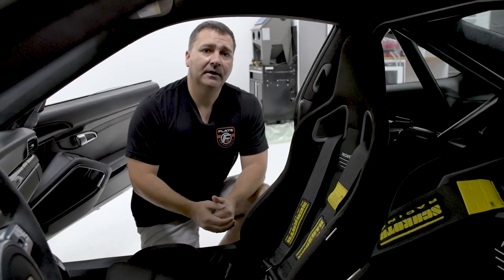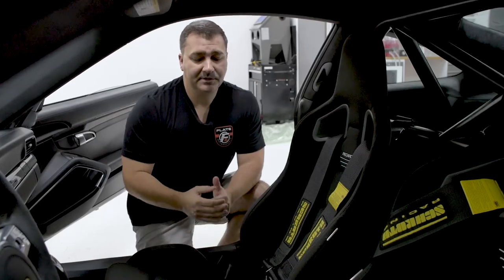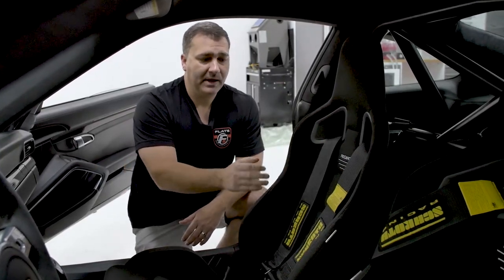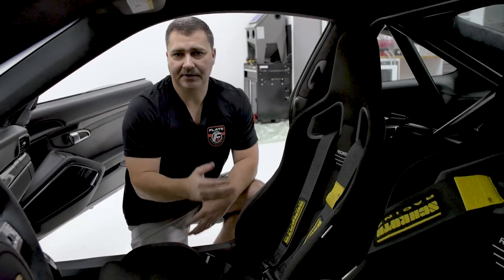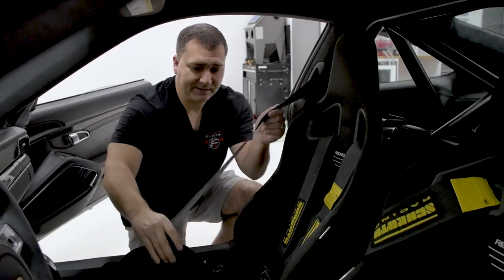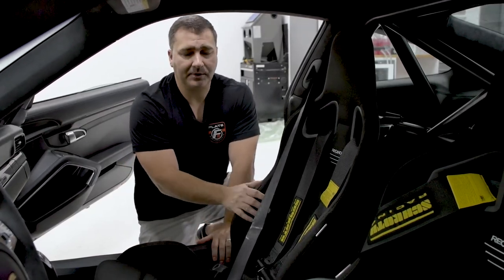One of the things you should consider with seats is homologation rules. If you run with PCA or other sanctioning bodies with track days, some may require a five- or six-point harness, and that's going to need a submarine belt through the seat. Because this seat can only accept a four-point harness or your traditional lap belt, we have to run a four-point. The roll cage has two attachments behind and two on the side, which completes the four-point harness. It has the quick release — very good, going to hold you in. The really nice thing is you can tuck these back behind and still use the factory seat belt. So if this is going to be a car used on the street and also at the track, you can leverage your factory seat belt, which is really nice. The factory seat belt works really well with these seats — very comfortable.